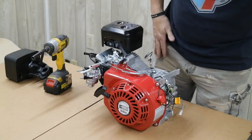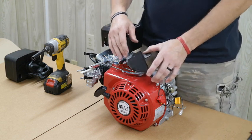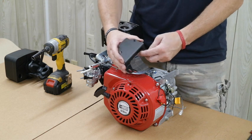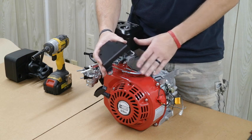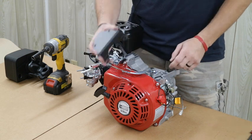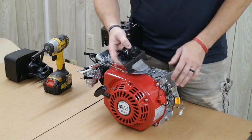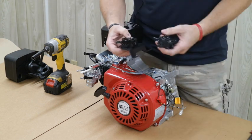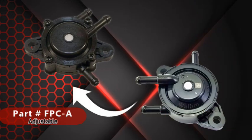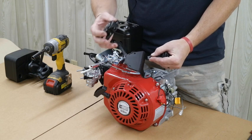With the stock tank out of the way, next we're going to move to our fuel pump bracket. A lot of people use a full top plate like you'd see on the clone engines, but we choose to use just the bracket because it's a bit cheaper and we don't have a wasted throttle assembly. We do have two different options of fuel pumps: the adjustable pump with screws to reroute where the lines go, and the non-adjustable. In the future the non-adjustable is all that will be available, so that's what we're going to work with today.